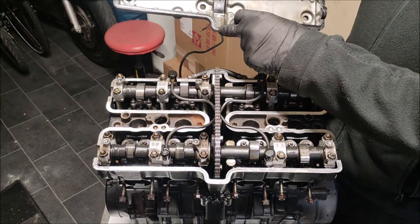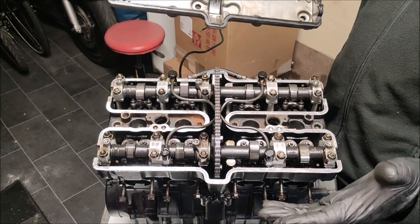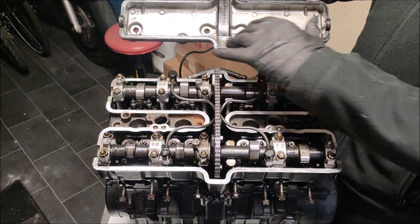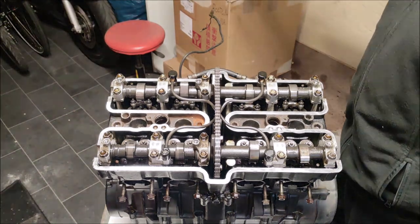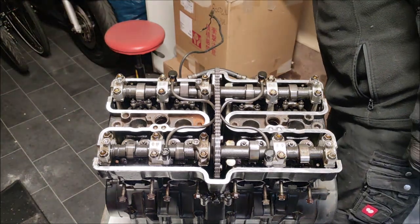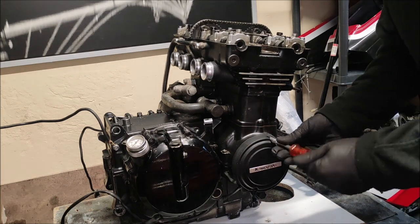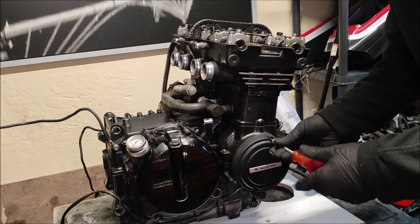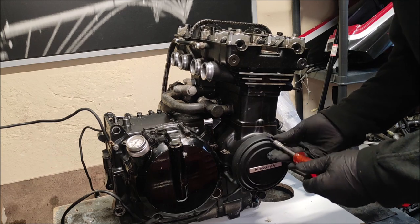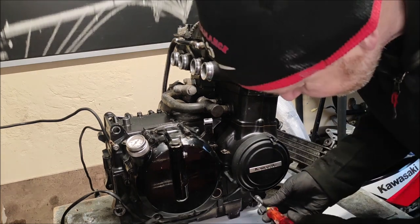The gasket has stayed in the head - sometimes it falls out - and it reveals everything underneath. Now I've got the engine open I may as well go ahead and do my valve adjustment. I need to take this cover off here so I can get to the rotor under the pickups - you'll see what I mean in a second when I have this off.